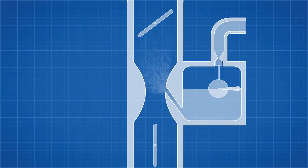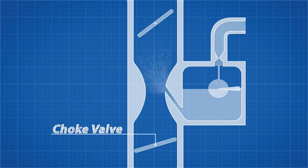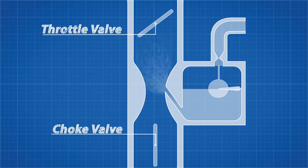The air-fuel mixture percentage can be altered by opening and closing two valves. The first is the choke valve, which closes when starting the engine. This increases the drop in pressure even further and draws more fuel from the float chamber, resulting in a richer air-fuel mixture needed when starting the engine. But an over-rich fuel mixture will not cause an increase in power — it will actually stall the engine. Remember this for later.